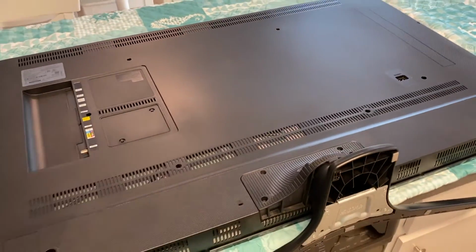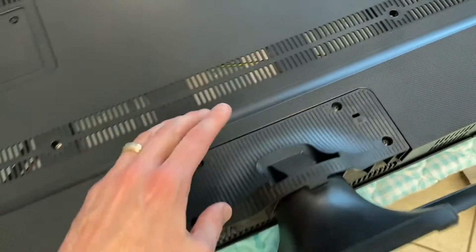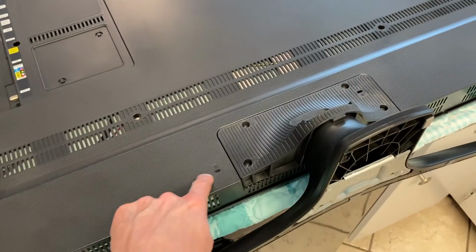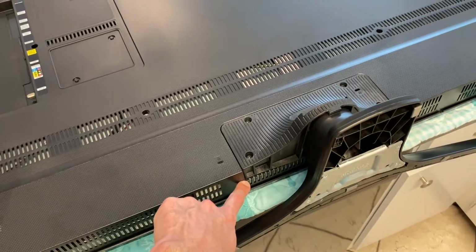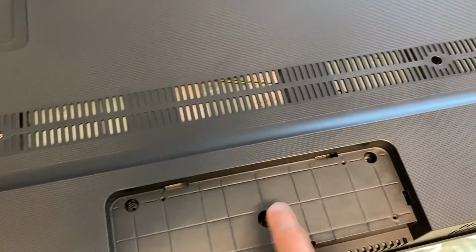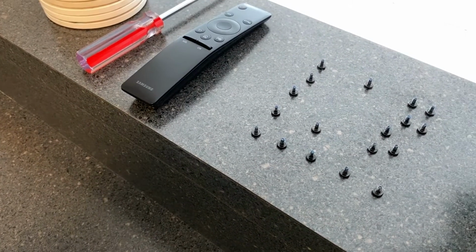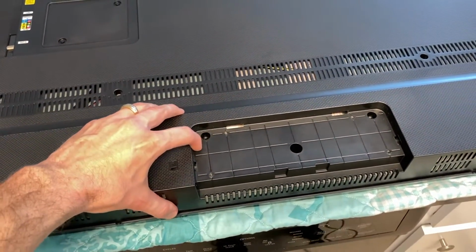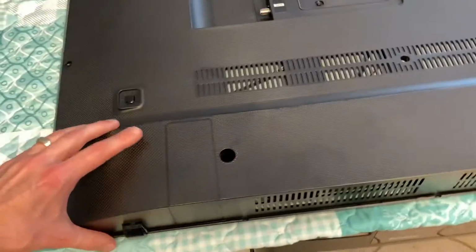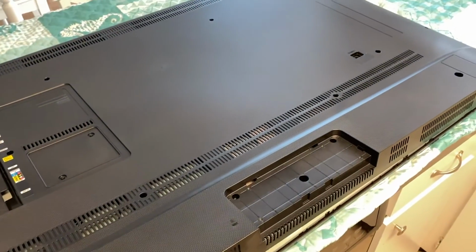If it does not, you're missing a screw. Try to find it. We've got the space here, and we've got a few Phillips screws. We actually need to remove this also because there are additional Phillips screws underneath here that we have to remove. At this point, I've got all Phillips screws removed, including the base, and underneath the base were those 3 additional Phillips screws. I've got these screws organized and placed in a manner where I will know exactly what screw goes in the exact same holes it came out of. From here, again, it should be extremely easy to pull up. It's heavy to do it with one finger. And again, if it's not pulling up extremely easily, you're missing a screw. We'll go ahead and pull this off with both hands.